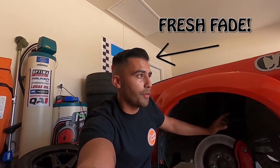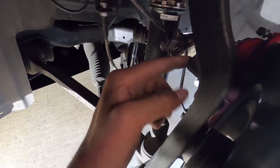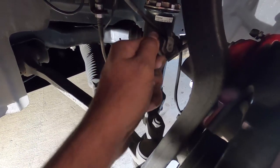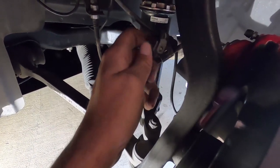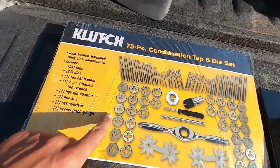I got back and put the rear wheels and tires on with the Nitto street tires. Now I've got to fix a bolt that goes into this upper knuckle here, because it's stripped - either the bolt itself is a little stripped or the hole the bolt goes into needs to be tapped out. I got a tap and die set. This bolt holds the speed sensor and the brake line and it just won't thread into the hole, so we're going to clean up those threads.